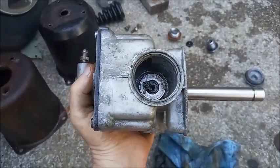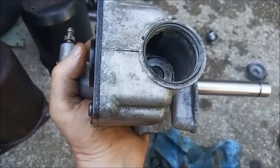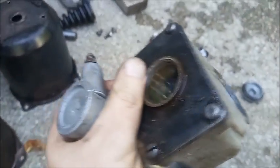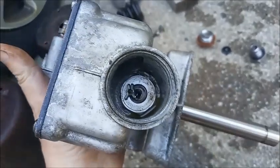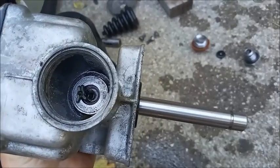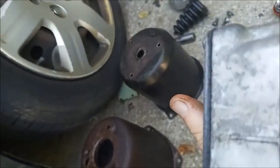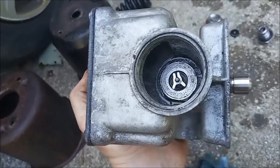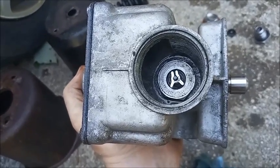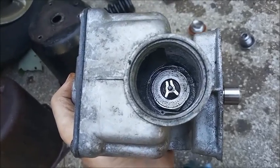The cover removed, we can see the compensating valve. That valve right now is open, allowing fluid to go between the reservoir and where the piston is pushing the fluid out to the wheels with the brakes released. Once we push the plunger in, that valve will close. And now fluid can't go through there, so that when you're applying the brakes, it's not pumping fluid into the reservoir. Very different than how the Delco Moraine does it.